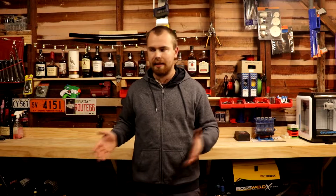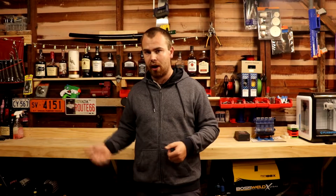This will overcharge the battery and eventually damage it. It's a really common thing to see on a car that has just had a new battery fitted without the registration done correctly. That battery will generally only last between one to two years, which is not very good battery life. Battery life does depend on many factors — how often the car is driven, how many times the battery has been flat — but battery registration on European cars, especially BMWs, is a really important part of battery maintenance.